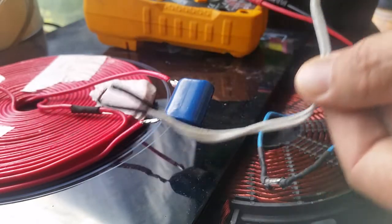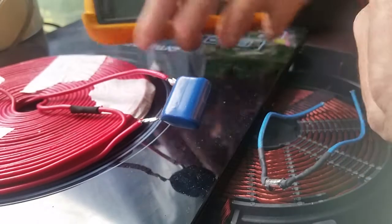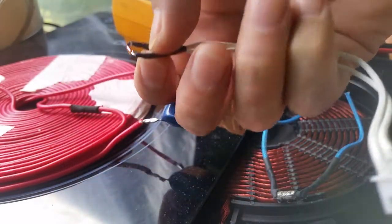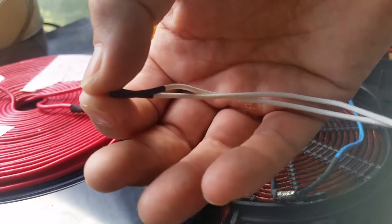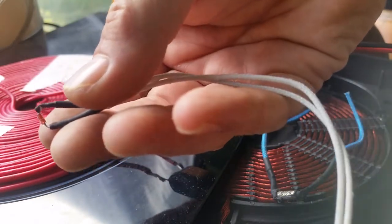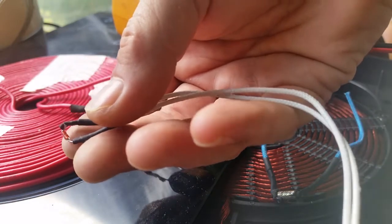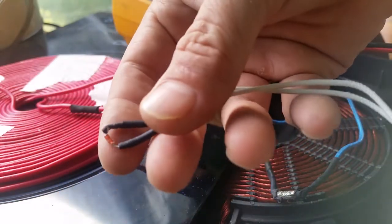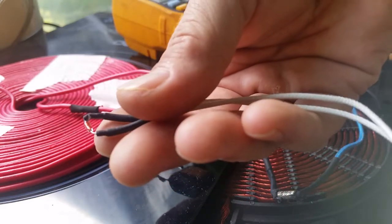The curious one is — what's this thing? I've just probed it on the multimeter and it's giving a reading of 100k ohm, and if I hold it, the temperature of my fingers makes that go down. So I believe this is also a temperature-sensing feedback to the board. It's not a diode — I've checked it on diode check and it is open circuit both ways on diode check mode. So it's a thermistor, I'd say.